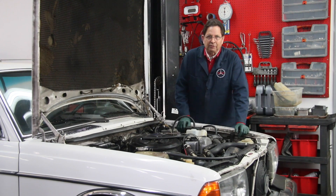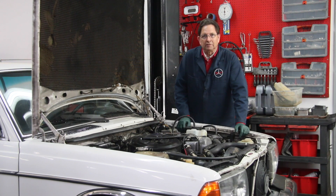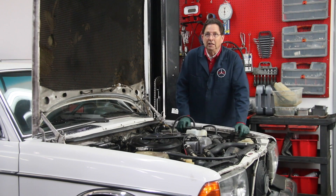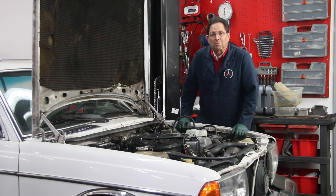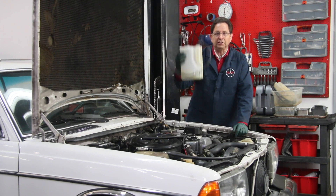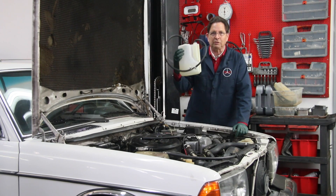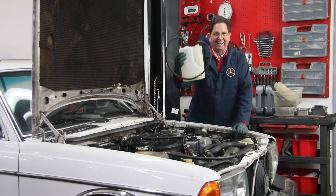In this case, I don't think the fuel is the big cause of the black smoke. I did notice it ran a little bit better, and I did take it out on the road and noticed a little more power. So obviously old fuel does affect the performance of a diesel engine. Here it is, folks — this is our emergency fuel tank, our diesel purge tank, and our engine fuel system test tank.